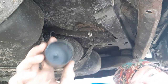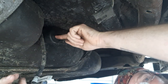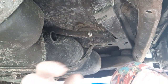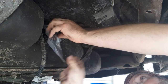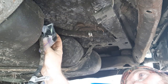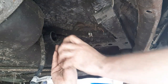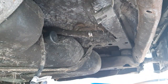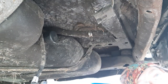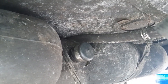I was just sitting here thinking — I got this little cap and it fits that pretty good. I'm going to put a hose clamp around that, probably keep from making a mess. Also a little sandwich bag with a hose clamp over that would work too. Because I don't really like the smell of fuel, and I don't want it right by the door to my house. So I'm going to try and keep the mess to a minimum. Now we'll get our jack under here and start pulling the rest of the fuel tank straps.